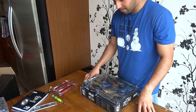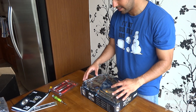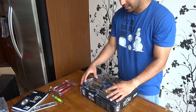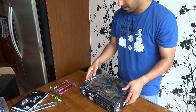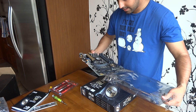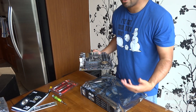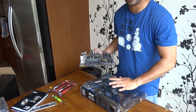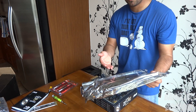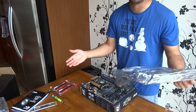Here's what most people get wrong with the motherboard. This is an anti-static bag — components like graphics cards come in one of these to prevent static buildup during shipping. The key mistake: most people take the motherboard out and place it on top of the bag. The inside of the bag prevents static, but the outside does not. It's safe to place it on the motherboard box instead. Once you've removed the component, the bag is essentially garbage unless you need it for storing old parts.